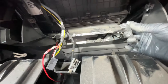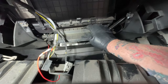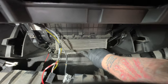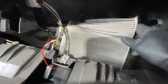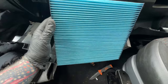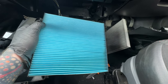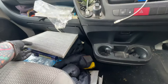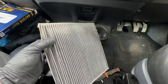These two little screws — this flap pops down and in here there's the cab filter. New cab filter going in. There's the old one down there. That compartment is replaced — that's the old pollen cabin filter. We've got a brand new one in there now; hopefully that'll make a big difference. Done — next!